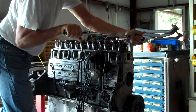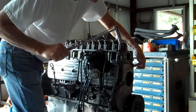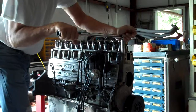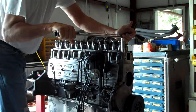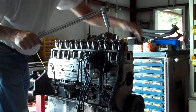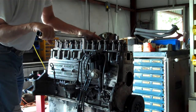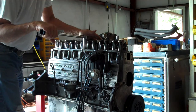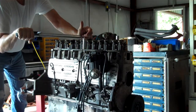I'll probably leave these front two head bolts since there's not a whole lot of material down in here. Even though there's more than on the 250 engine — this is the 292 so it's got a lot of meat up in there — I probably won't take it up to 95. They recommend tightening these two to 85; that block has a tendency to crack on these two corners. So from 50, I'll take it up to 75 and then do one more pass after 75.